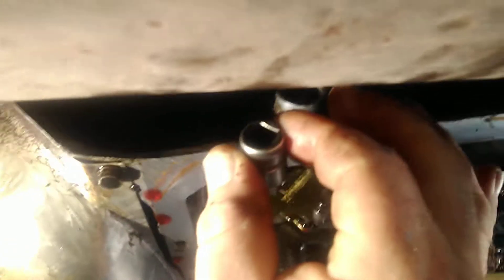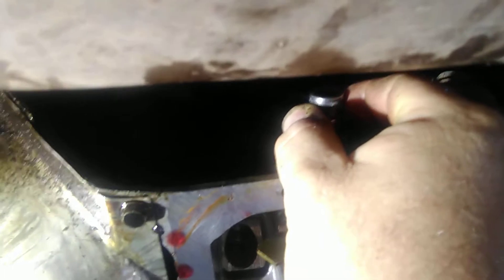It's a little bit of a trick to do this because you can't get a hammer up in here to bang that seal in. What I do — depending on what room I've got — I take a socket that's the size of the seal or a fraction smaller, put it up in there on the seal, and then I take my pry bar, most of the time up against the exhaust, and I lever it in like that. Now I've got some goop.